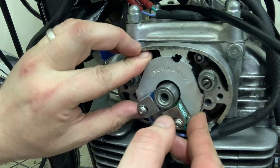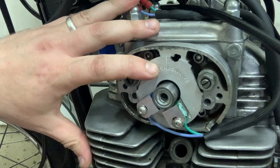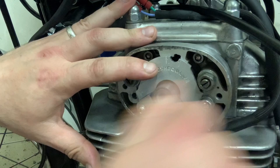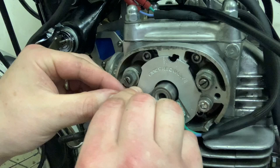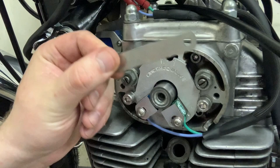This will just kind of slop right into position, and I should have taken a picture of where I had it timed out, but I didn't, so we're starting totally fresh. I'm just going to loosely install the shockwave plate onto my points box here — loosely. Don't want to tighten this thing up yet, and according to the directions, you want a 0.3 feeler gauge on this. So grab your 14-millimeter wrench.